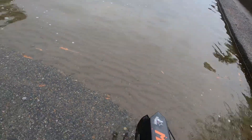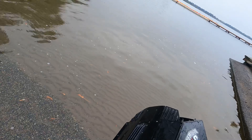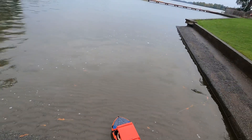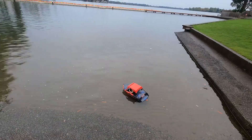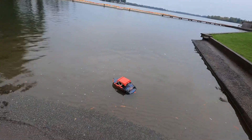I'm trying a different intake — this one is actually from the Pro Boat River Jet. It fits the same bolt pattern, but the grill is a little bit wider, so you've got to be careful with that. It can allow a little bit more debris in there versus the stock one, but I just wanted to give it a shot.